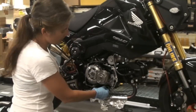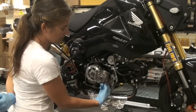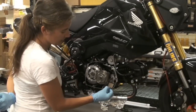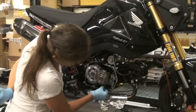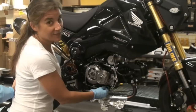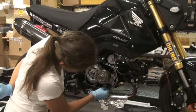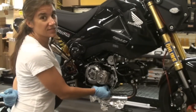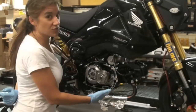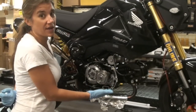The next step is to remove your filter screen, inspect it, make sure there are no big metal chunks in it, clean it, and reinstall it. You want to reinstall this filter screen — per the instructions it's required, as it serves as an extra backup system.